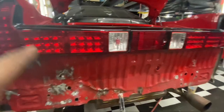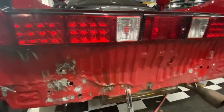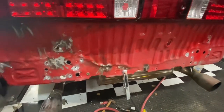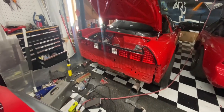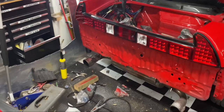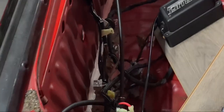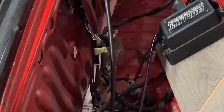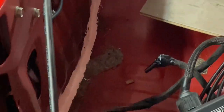Got the taillights in. This is still all mangled here but the bumper should fit back on — at least I can drive it around until I figure out what I'm going to do about reinforcing the hitch on the frame. All spot welded and painted up like it never happened. Almost — except for all those little crinkles right there, but you'll never see that. I was able to butt up the rear pan so you couldn't see any daylight anymore, but I wanted to waterproof it anyway so I re-seam-sealed it.